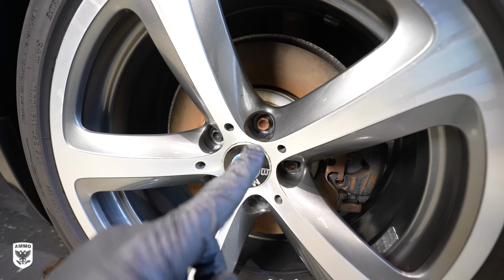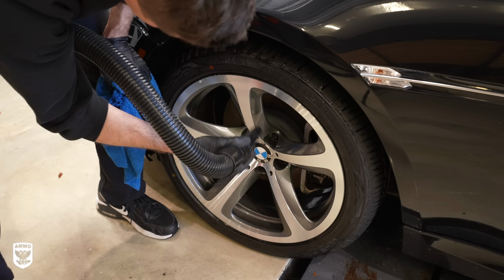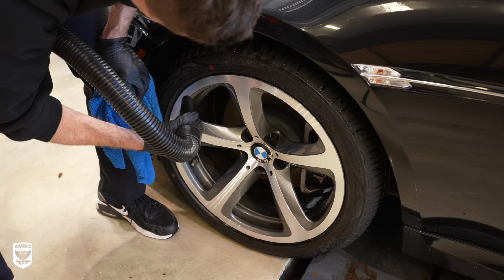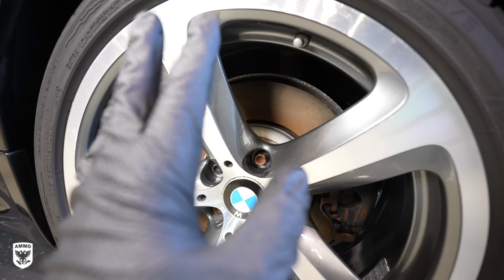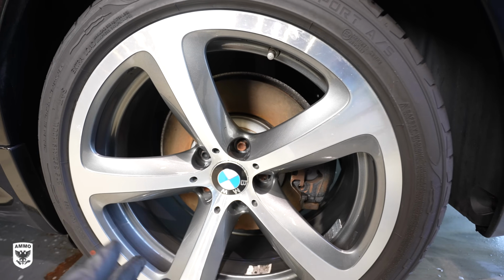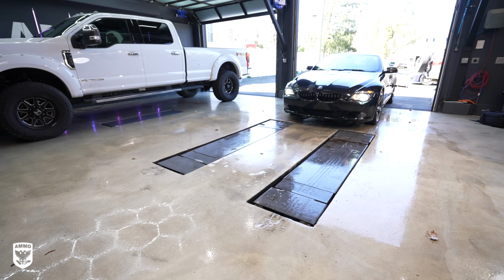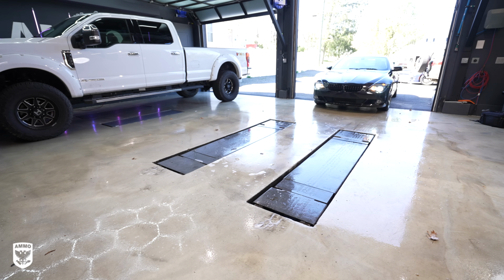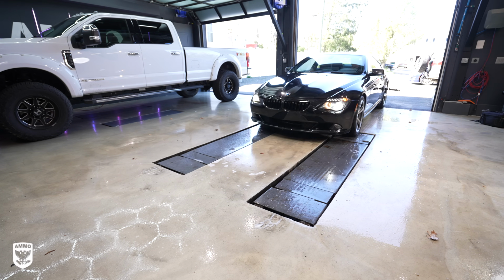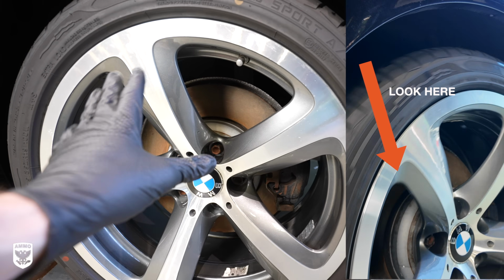The way you get around it is two ways. One, you use a lot of compressed air. You can use a compressor or one of those warm air blowers and really focus on the instant you finish cleaning the wheels in terms of water, dry it off immediately, and that will have less moisture and less rust. The other way, because I let it sit so long because of the filming, is I can back up and go forward, back up and go forward, and then squeeze the brakes so that the caliper squeezes the rotor and kind of just grinds that all off.